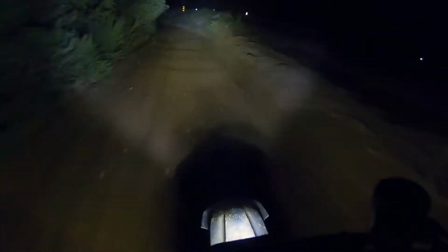Woo! With Alex being a pro racer, I put the stock rev limit back on. It's right under 10,000 RPM, so it signs off pretty quick if you're used to riding a normal 450 motocross bike. You hear a lot about low lugging, but it is a big piston, 510 or 511 cc, pretty large. We also put the titanium valves in and the large throttle body.